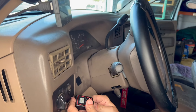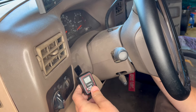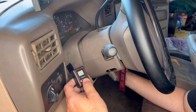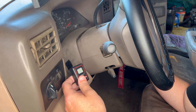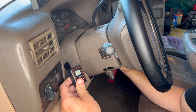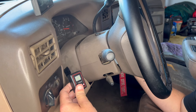So let's say you're ready to leave — you went on vacation, wherever — you put it in no-start. Now you're back home from the airport. Let's get your truck ready to start. We're going to plug it back in right there. Turn the key on. We're going to see that the truck was left in the NS no-start position. All we have to do is click into a different tune, cycle the key, and then the truck will start again. It has to do the key cycle or it will not work. Voila.